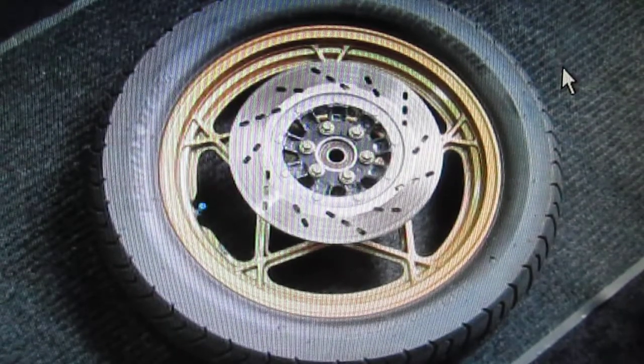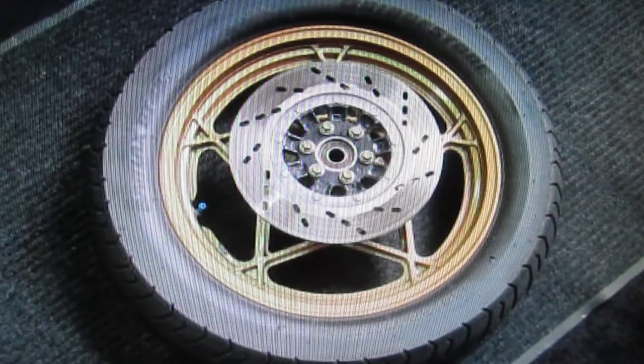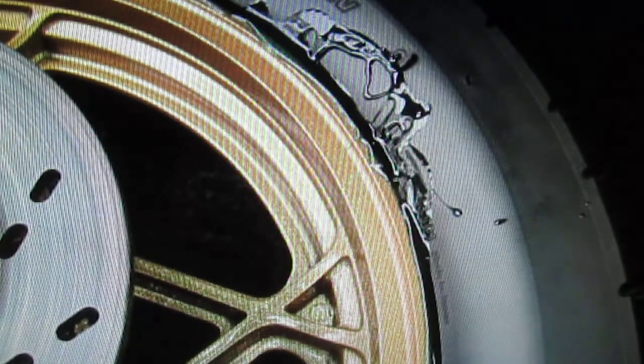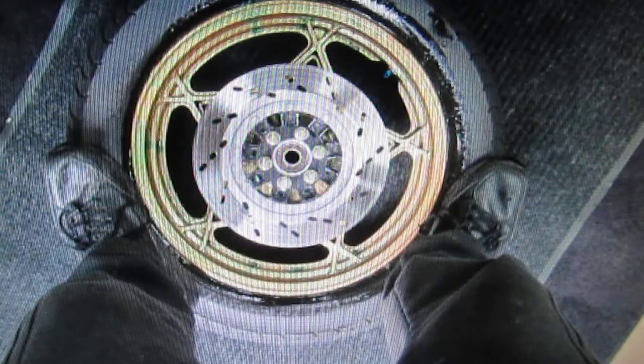You can see I'm working on an old rug - I always like to work on these old rugs. You can buy them at Lowe's or Home Depot; they're made for factory work, rubber-backed, so if you spill oil it doesn't soak through to your good carpet underneath. The trick here is letting the air out of the tire with my little tool - Harbor Freight again, everything is Harbor Freight! Good old Dawn dish soap makes the job a little bit easier. I do have a bead breaker, but I wanted to try the old school way of breaking the bead just by walking on it. I let the Dawn sit in there for a minute or two, then just start walking around the tire.